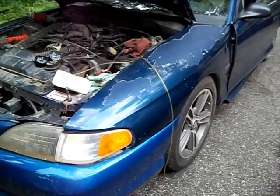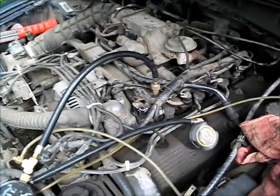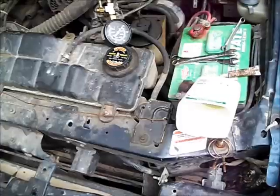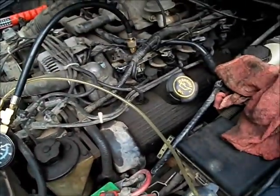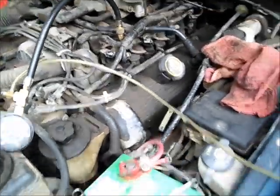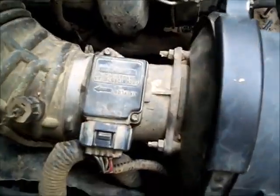This is a 98 Ford Mustang with a 4.6 in it. I was checking the fuel pressure on it. It holds fuel pressure for a while and then the fuel pressure just drops off like the fuel pump quits running. It's had a couple of fuel pumps put in it supposedly. I figure that's a problem in there.